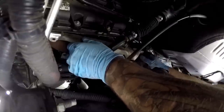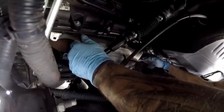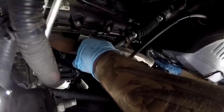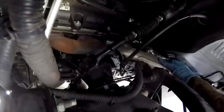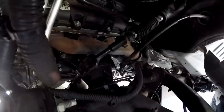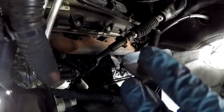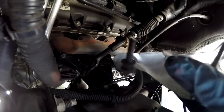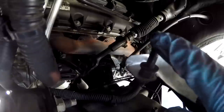It's a little difficult on this side because there are two studs snapped clean off. With the heat shield out, there's the culprit — two studs snapped clean off. This one looks like it should be pretty easy to get out; it actually just threaded itself out of the block. So there's only one truly snapped stud at this point, but we're going to replace it anyway. Hopefully this one isn't snapped too far in once we get the manifold out of the way.